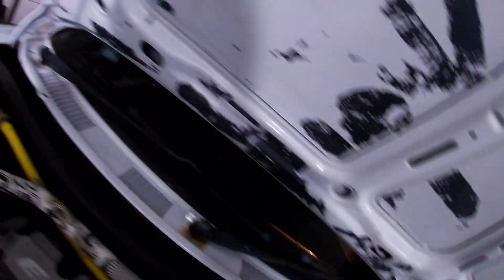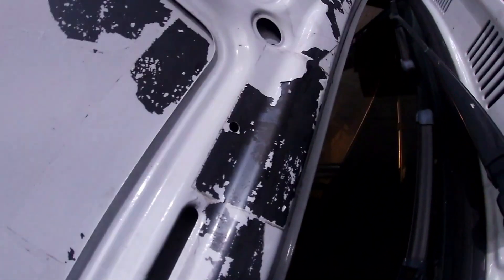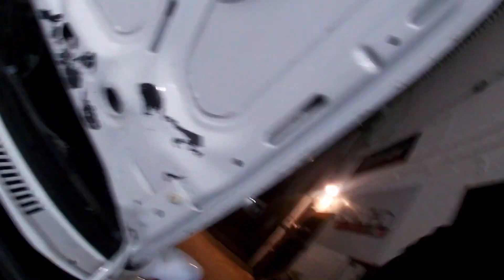Look, they're going to drop off — we've got the stickers off but it's taken a lot of paint off with it. It appears somebody who sprayed this didn't prep it very well — we've got runs everywhere, it's taken the paint right down to bare metal. I'd almost go as far as to say it wasn't primed. It's not the end of the world, we'll whip it off and give her a little spray under the bonnet. You can just pick it off — we'll have to make sure we get all that off before we give her a spray. The chassis doesn't look too bad, there's no rust on that, so that's a good bonus.